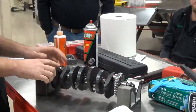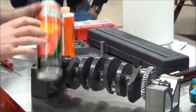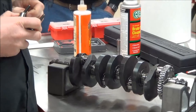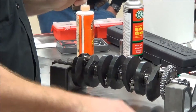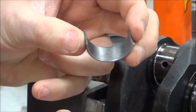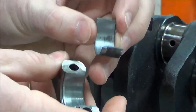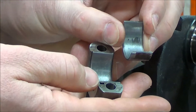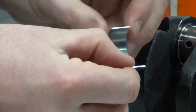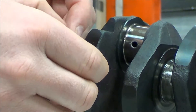A couple things we've already did is we went ahead and cleaned this really good with some brake cleaner. We want a spotless clean area. We don't use the assembly procedures when doing this except for the part when it comes to torquing. I've got a bearing here that's just loose on here. There's two pieces to it — the other half is still in the cap here. We have a locating tab that we can use to pry it out, and we'll basically take a pick or a screwdriver and pop that out. We definitely don't want to bend this or pinch this in half to deform it. One of the other things is not to touch this with our fingers because the acid on your fingers can etch into that and cause it to rust and affect its performance.